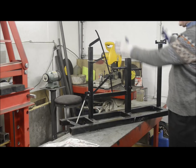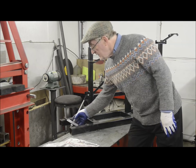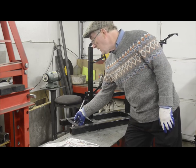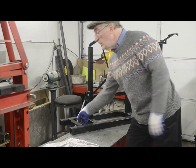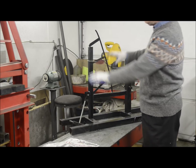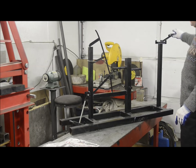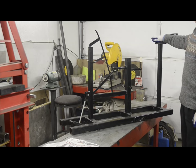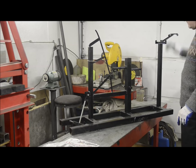And the way we'll do that is, when the frame is sitting in there, we will put the front forks in, as you'll see. Then this piece here will be clamped into the bottom of the front forks. The front down tube will be heated, and then this will be turned to pull the forks, and the whole thing will swing around until we get where we want, and that will hold everything while we do the other fabrication. The rear part here, as you'll see as we use it, is to mount the top mountings for the rear suspension units and the mudguard.